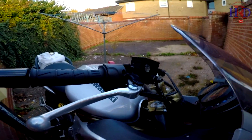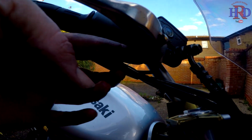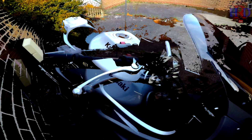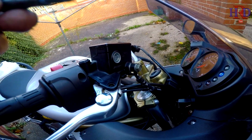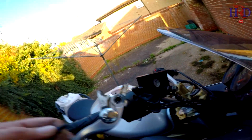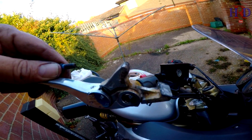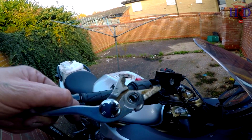We've got to move on to the brake side, which I think will actually be a little easier. This is the same sort of bolt — it's not got a bolt on top, there's a screw thing. Just put the screwdriver in and hold it while you undo the nut underneath. That comes out, the lever comes out, the lever goes in, the bolt back in — done. I've got the nut off the bottom. Someone's put Loctite on it at some point, which I think is unnecessary for something like this. So that's off — it should just come straight off. Now I've got to get that pin out of this one because it's a bit different to the other one.